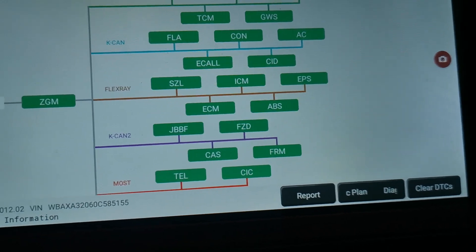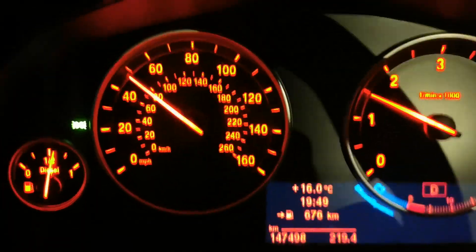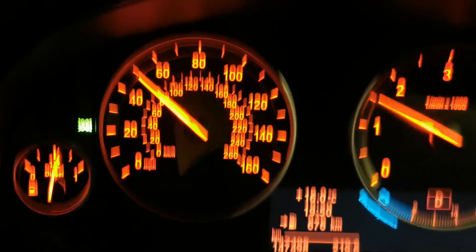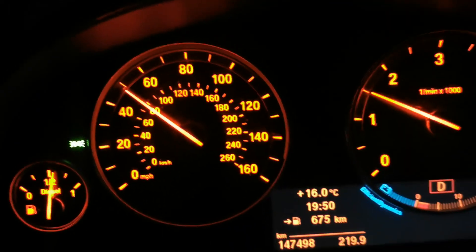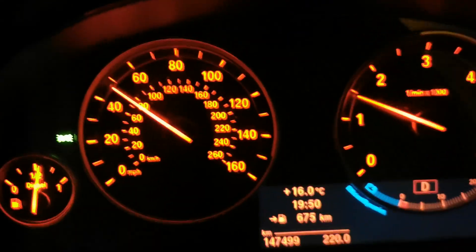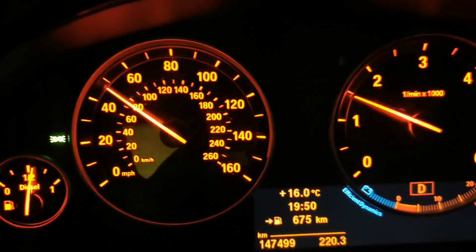So far so good — we are in the green. Road test time. Full performance has returned on the final road test. The twin turbo is back in action, no drivetrain faults, no codes coming back. I'm monitoring live data beside me as I do the test drive and everything is good. If you've come across this problem before, check for broken vacuum hoses or a damaged connector in that area. Also check for an air intake boot that's torn — any of those issues could potentially cause that fault.